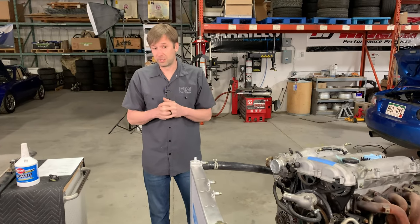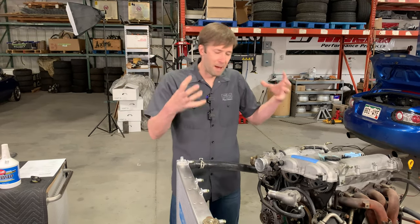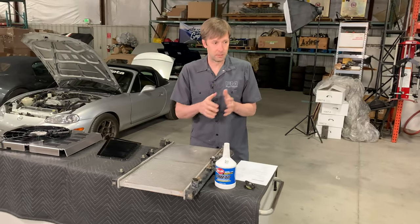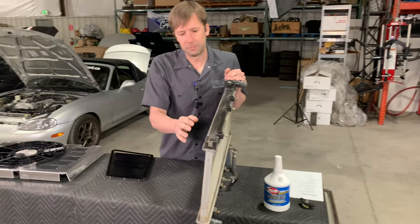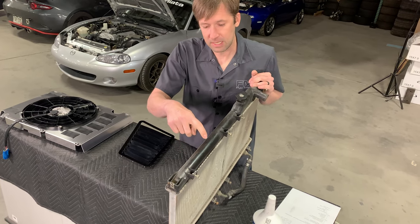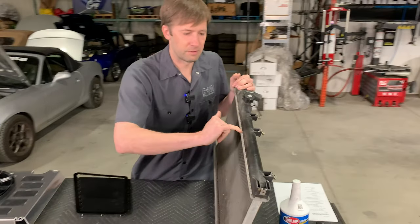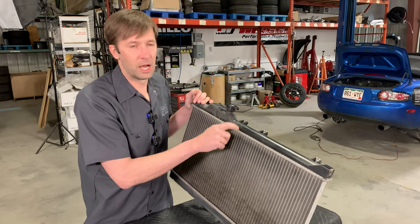You want to make sure that you don't have leaks. If you're bleeding coolant off, your coolant level can drop, which means there's less mass of coolant to absorb and shed that heat. You can do a pressure test, which is good because that will show you all those parts. One thing: if you still have a stock radiator, if the plastic is brown or green, you need to replace it before you have a catastrophic failure. Also, if you have white crusty stuff along the junction between your plastic tank and your aluminum core, that's an indication that you've got a coolant leak right there. Replace it.